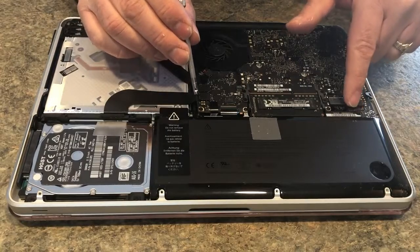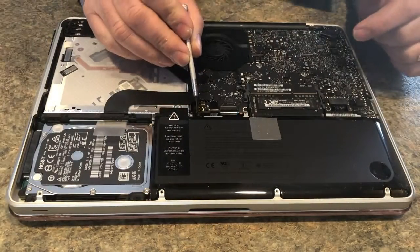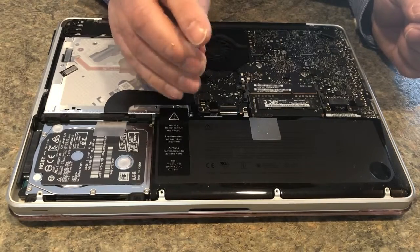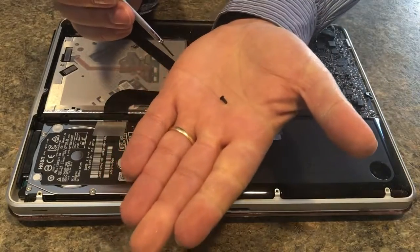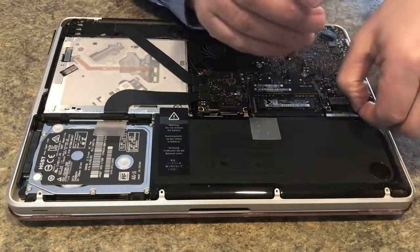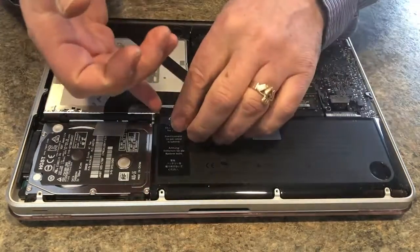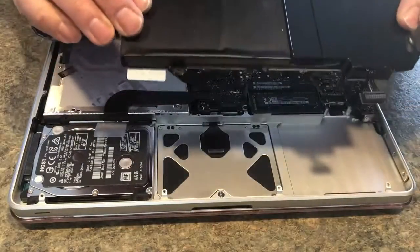What I'm going to do is remove the two battery screws. I'm using a number one tip Phillips screwdriver for the case screws, but for these I'm using a very fine eyeglass flathead screwdriver to remove the two battery screws. Just don't strip them. If it's not working you can go online and buy the right tool — they kind of look like a Phillips screw but they're not. Both screws are different sizes; I'll put them aside. This is the connector right here for your battery. Use your fingernails and just wiggle it back and forth. Once you do, you can remove your battery — lift it up and slide it towards the back of the unit. There's your battery.